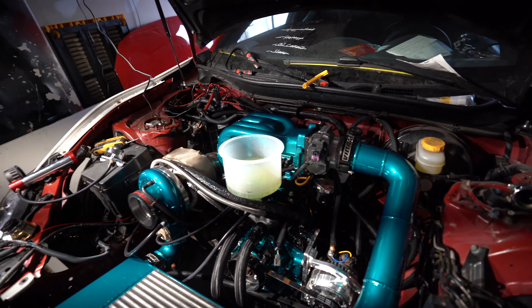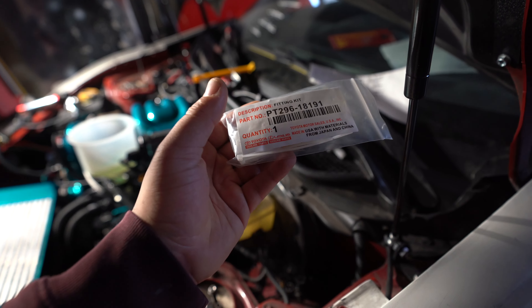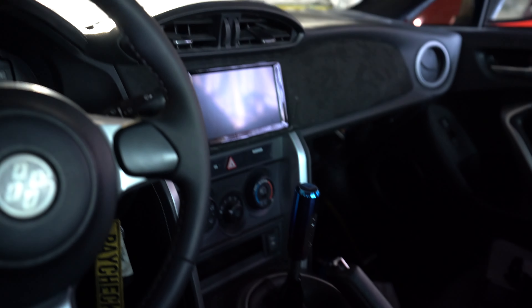My goal is to just let this car run for as long as possible. My laptop's in Charlie's car, so I'm hoping he brings it very soon because he leaves for Puerto Rico tonight and I need it for this. What I recently did is I went through and placed vacuum caps around the car to negate any issues with leaks. I'm working on relocating the water pump, which I'm going to have to drain the system and refill again. I'm definitely going to have to make new lines for it. I also got a check valve for my brakes.